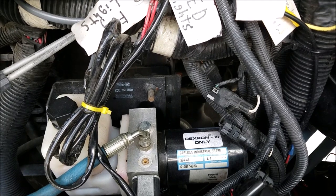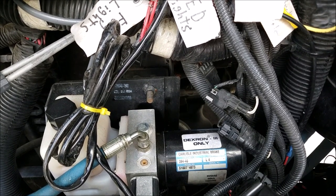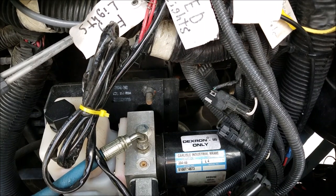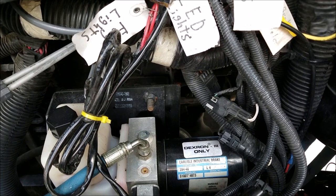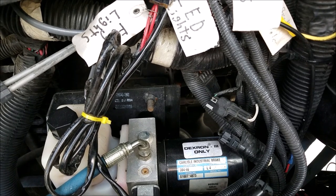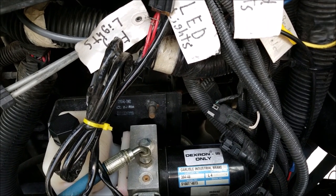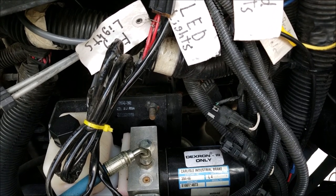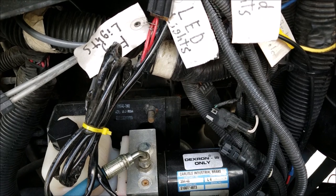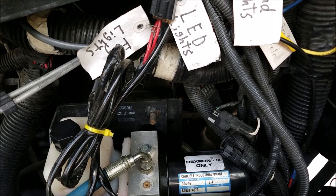I'm driving down the road thinking about all the stuff operating that could break at any moment — fuel pumps, water pumps, alternators. I've tried to keep spare belts. I've got the air conditioner bypass kit in case the bearing goes out on the clutch. If my electric fuel pump goes out in the fuel tank — this is the Workhorse chassis W24 with about an 80-gallon fuel tank — I created an electric fuel pump bypass kit. You'll see it on my video channel. Within 15-20 minutes I can plumb it up and be back on the road. That's solved. But I haven't solved what happens if my J72 quits.